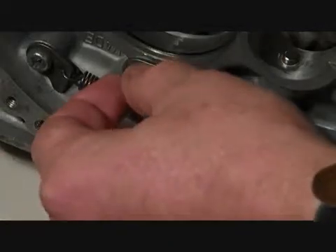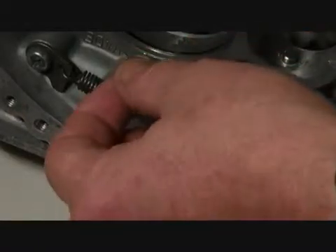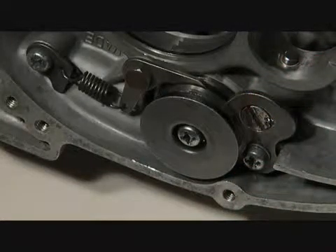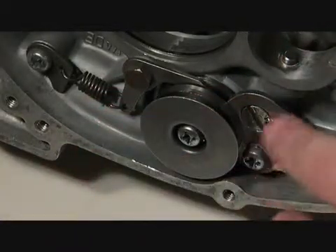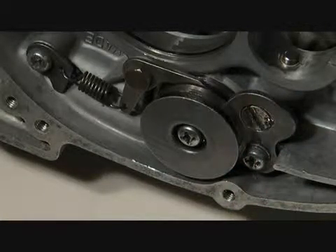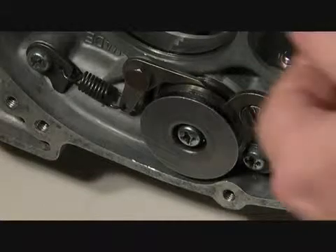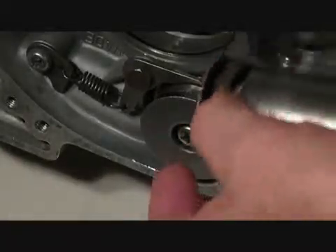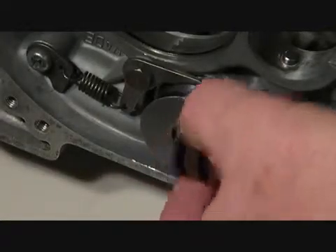The main thing to be sure of is that you get the hold-down arm onto the bolt shoulder before it gets tightened down. You've got two hold-down bolts — this is the plate that holds the shift drum in place. The forks hold the gear in place and the shift drum holds the forks. There's a lot of force on these two, and if they get loose they'll actually bend or break off, letting the shift drum move and letting the transmission pop out — which gets pretty violent, as you can see on this other shift drum that cracked and broke.